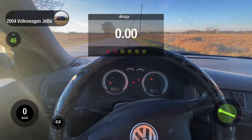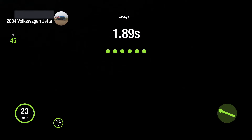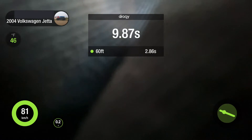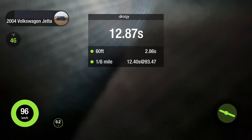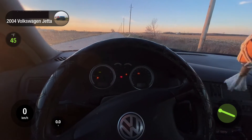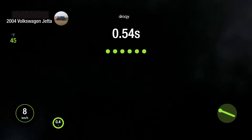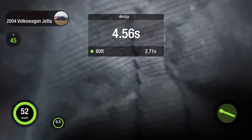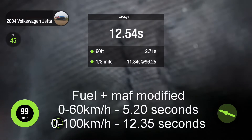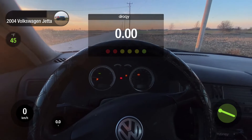Now let's give stock a try and see if it's any better or worse. Then we'll test with the fuel temp resistor and the MAF diode together, and then just the MAF diode alone with the fuel temp jumper out.